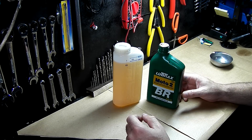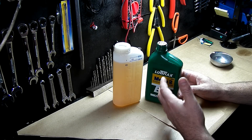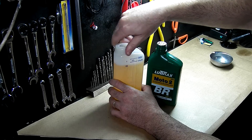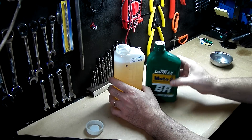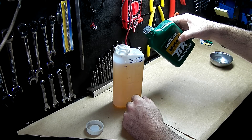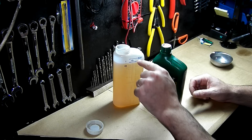Also, at the beginning of the engine's lifespan, take it easy during the first hours of use, and when you mix, add a little more oil. As we say here in Brazil, 'give it a little cry' when you're mixing — add just a little bit extra at the end. And that's the only oil you're going to put in; you're not going to add any more after that.